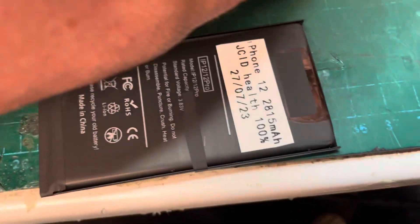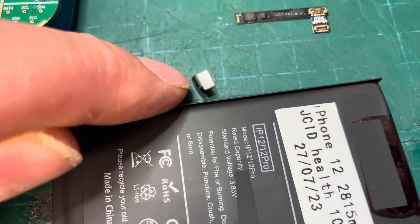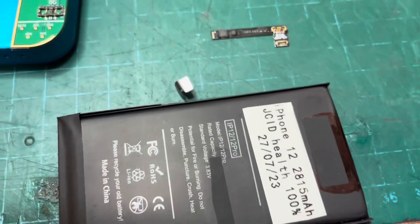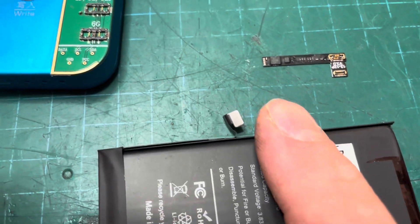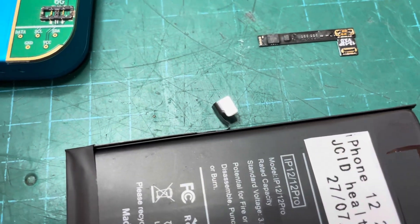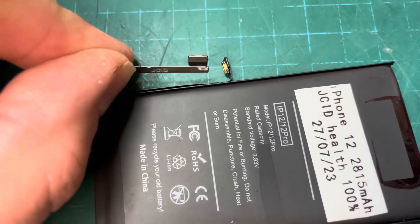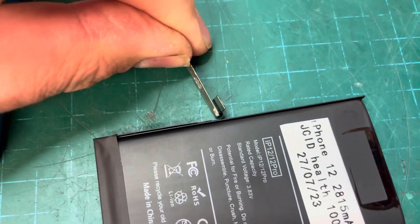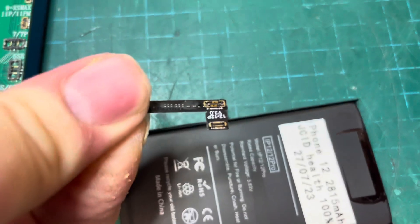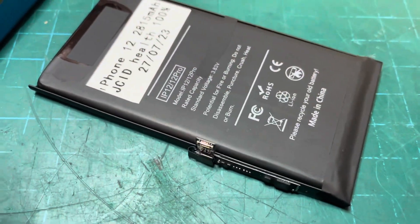This little flex cable here - to fit this little tag-on thing, we need to fully bend that over so it's back on itself. To do that, I'd like to heat it up a little bit. I've got my temperature heat gun set to 100 degrees. I'm going to get that flex hot and then it'll be nice and easy to bend it over and make it the right shape. On the back of that flex is a bit of sticky, so we're going to stick that to the side. Now we've turned that over, that will be able to click onto that, leaving us with the extra battery connector. That's now connected - we're just going to stick it to the side. Now you almost don't even know it's there.